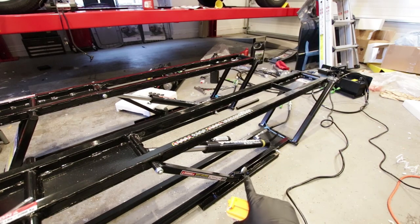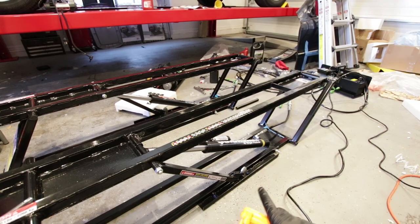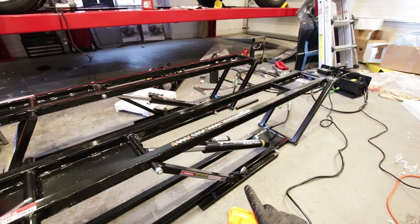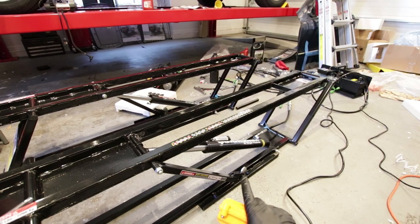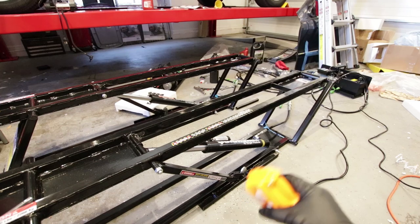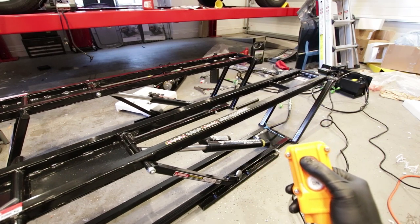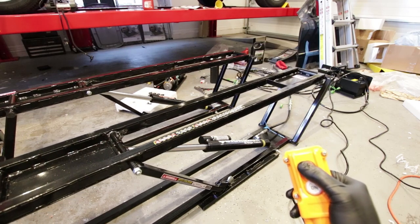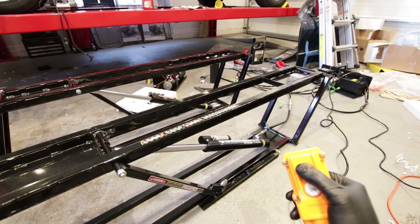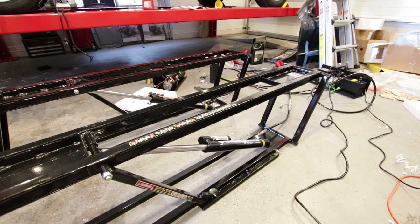And those right there, down here, those are the locks. Just like a jack stand, you'd never want to have a car just on hydraulic pressure alone, because hydraulic pressure can fail, there can be a leak. You always want to have it on an actual mechanical lock. And that's what these have. Just like my four-post lift has locks, this has locks as well. Very good feature. Let's see how high it goes. I think that's as high as it goes.